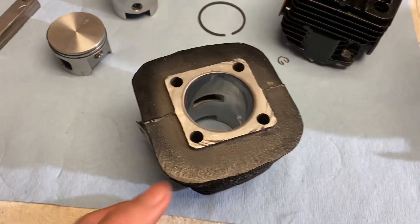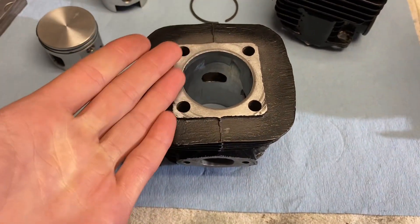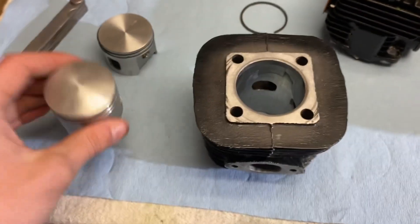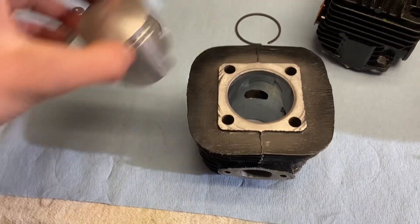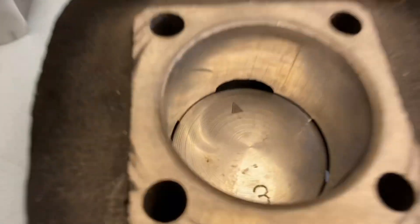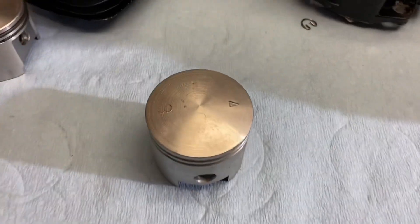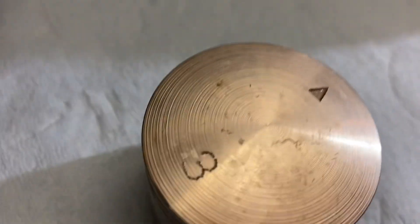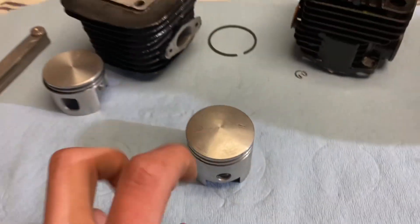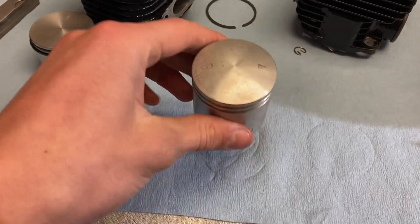Here's the way I look at it. Let's say your cylinder is just like so, and that is your exhaust port. Let's say your piston and piston rings are on, just like this piston. So this is the correct way to do it, but you never ever want to just go by the arrow. The reason I say that is because these pistons are just stamped after they're made. You can see this one has the number three on it and has an arrow. The arrow is supposed to usually go to the exhaust — I say usually because sometimes these things can be incorrectly stamped.